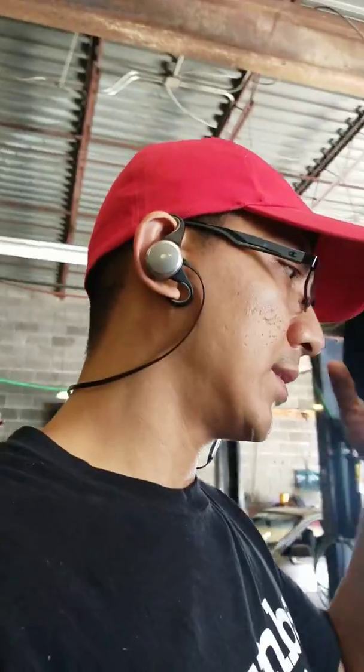Probably they're worn out, or it's a service indicator per mileage that goes overdue and you need to service them, even though sometimes they're not even worn out yet. But some nowadays have a sensor on it that needs to be replaced every time you replace your brake pads. And in some cases, cars have a specific procedure when you're replacing pads. You gotta look at that first before you try it, it's not just a simple job.